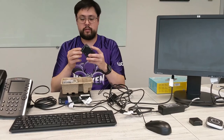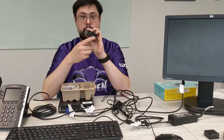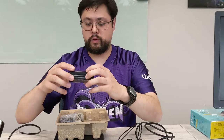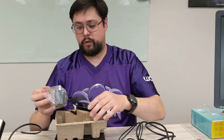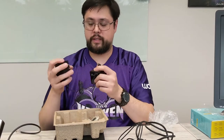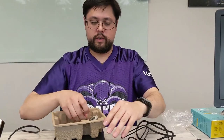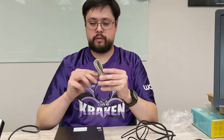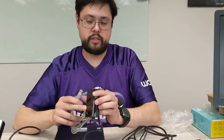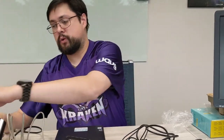This is the device you'll be working with. The way it works is it's got a power input, ethernet on one end, and ethernet on the other side. We'll go ahead and connect power first, then the cables from your home network to the device, and then to the phone. It comes with a power supply with an AC adapter and a little barrel connector — just slides right in. It also comes with an ethernet cable, and for this cable, you want to plug it into the power and data out connection, and then the other end will go to the back of the phone.